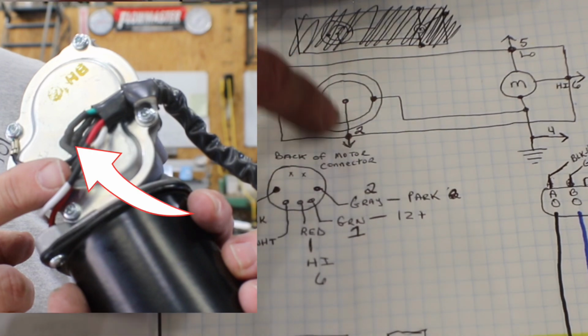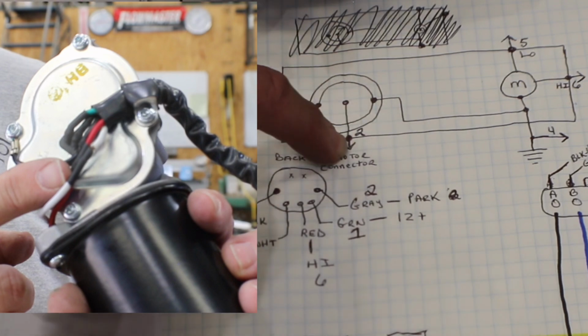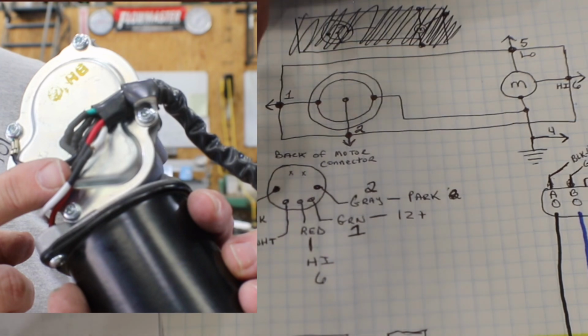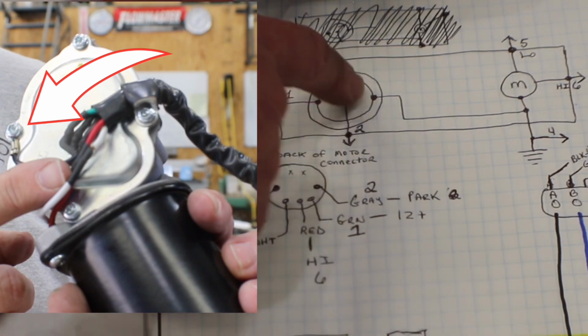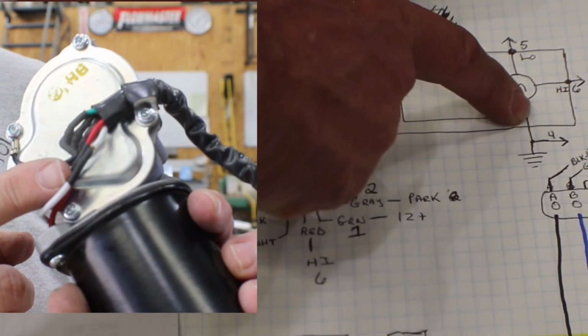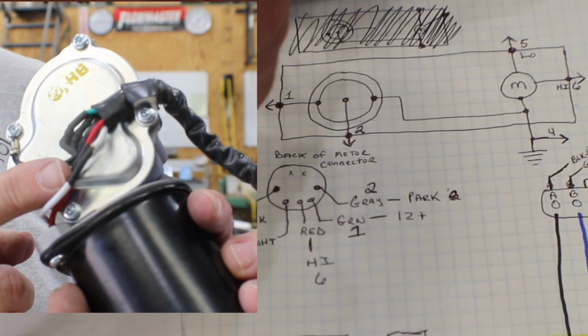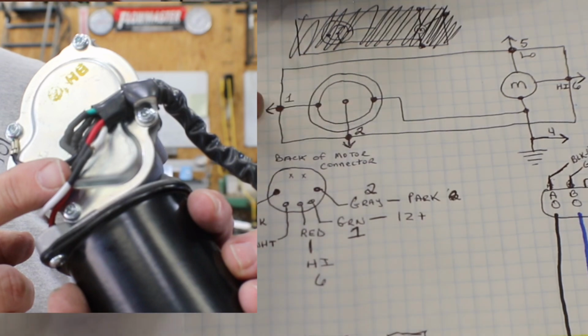It is what is number 2 here, and that is representing the park position set wire. The black wire, the way you know is because it's got an additional black wire coming to it, going over here to the case to ground the case. So that is this wire coming out, going to ground, becomes pin 4. So now we've settled the far one. The middle one is here. Number 1 is going to be green.